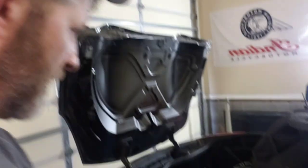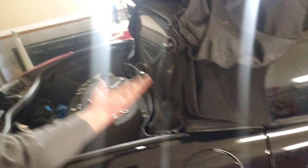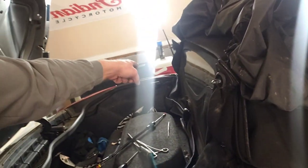So I'm thinking to myself, how in the world am I going to get in this trunk? I opened up the door and was looking around in here, wondering if I'd have to remove panels — I had no idea. I've never worked on one of these before. But I could tell by moving the deck lid that it was released on this side and on the far side, and it was pivoting in the middle. So I knew it was latched in the middle. I thought I would have to take off inner panels behind the seats to get to that latch, because the cables were already released.